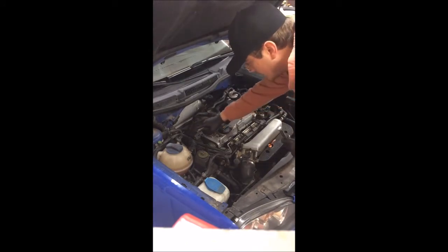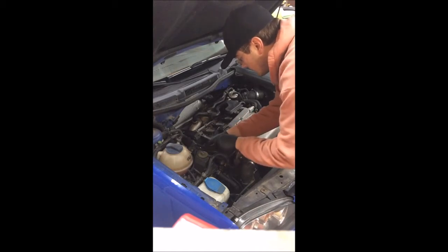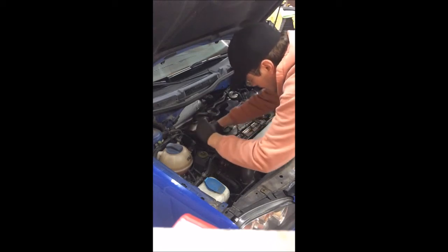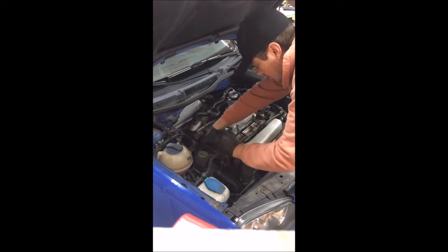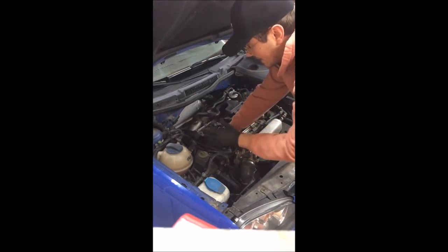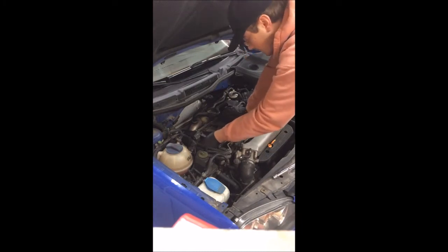So let's set you back down. Again, no sense in taking out the cover here, just enough so you can get your ratchet in here. Now this is a 1/2 inch drive socket and ratchet here, so if you have a 3/8 or a 1/4 inch, you can certainly get it in here with enough room if I can get a 1/2 inch drive in here. So I've got those broken loose, and I'm going to take them out the rest of the way by hand.